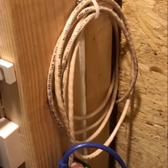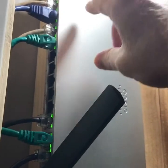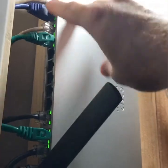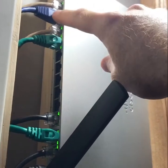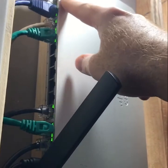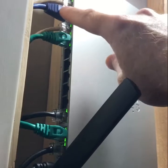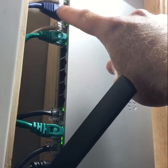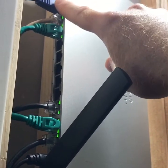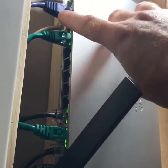We have the Ethernet cable running in from outside down into the basement along the wall. The MG21 is plugged into the Cisco PoE injector — into data out, power out — and then on data in we have WAN 2 or Internet 2 on the MX-68CW. One thing you'll want to do if your plans — like ours — have fixed devices like the MG21 that don't have unlimited data like a phone would: I configured the MX to only build its VPN tunnels across WAN 1 and use WAN 1 for all traffic, only using WAN 2 if WAN 1 fails. That limits data utilization on your cellular connection, keeping it essentially just for keepalive to confirm the cellular connection is good.